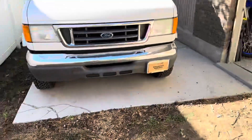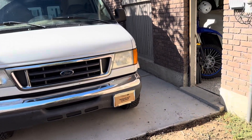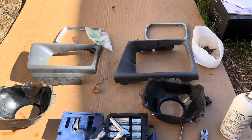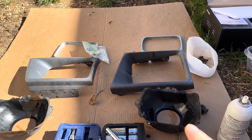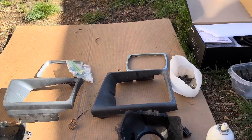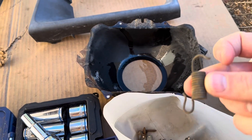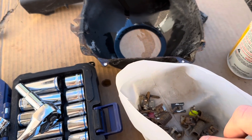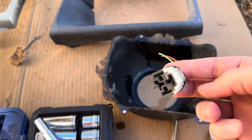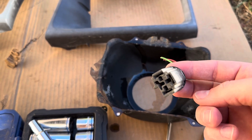The goal is to remove all that and install the components for the sealed beam lights. These are the components here — I've pulled a lot of this from the junkyard. We've got the buckets, the trim ring, that other little trim ring that holds the sealed beam headlights in, all the screws and other components we'll need, and these little springs that provide tension on the lights. I also pulled these pigtails off the junkyard because the plugs required for the sealed beams are different.